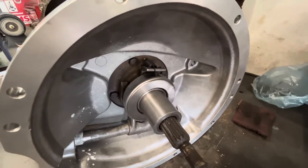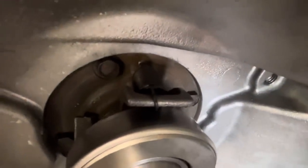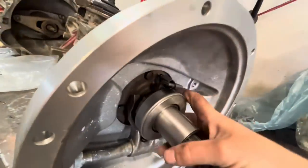Jim drilled, and can you see in there? It might be a bit weird. He drilled and tapped a hole there, threaded a quarter inch bolt in, and then just simply drilled a hole through the top of the bolt after cutting the bolt head off. And that is how this spring attaches.